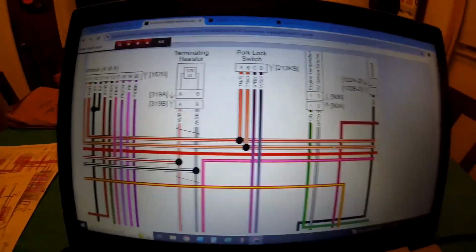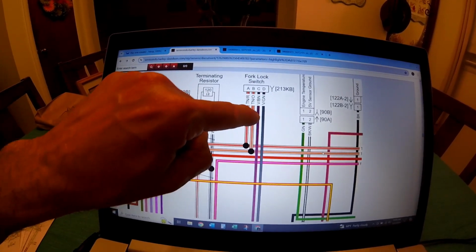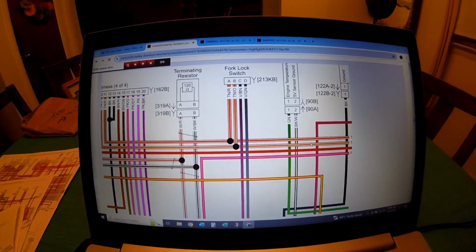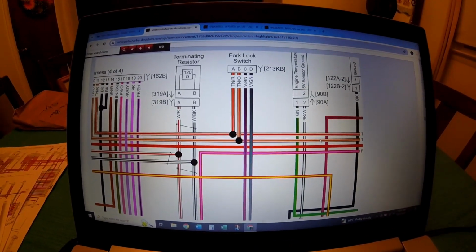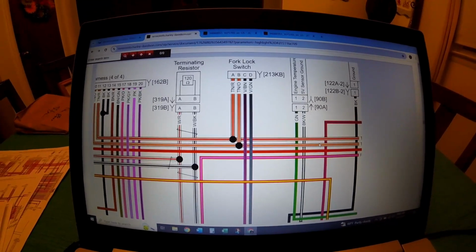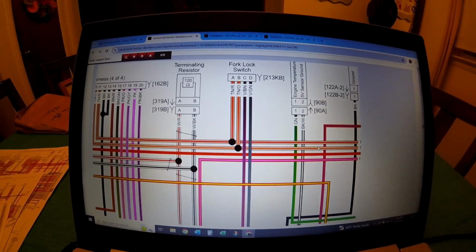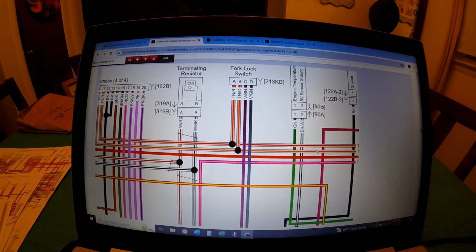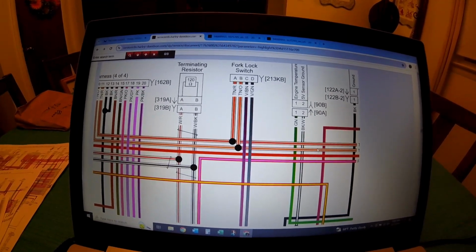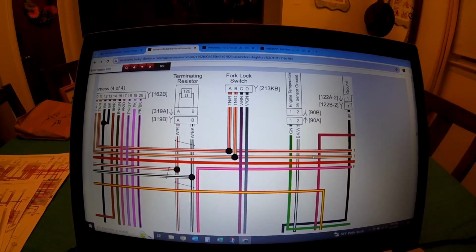When you tell all the locks to unlock, I believe this C wire, it's a violet with a brown tracer, will go to the proper voltage to tell the BCM computer that the bike is unlocked. Then this gentleman thinks that they can flash the computer to eliminate it altogether, and then he'll be able to ride his bike without having to buy an expensive module. So I hope this helps anybody dealing with this problem. I haven't put my hands on one of these bikes, nor do I want to at all. I'm all about my old bikes. If you're watching my channel, you already know that.